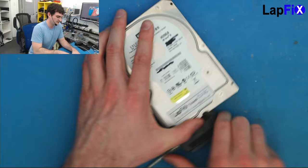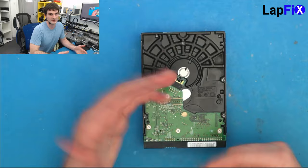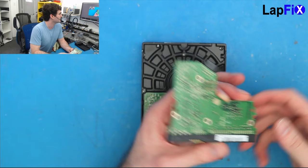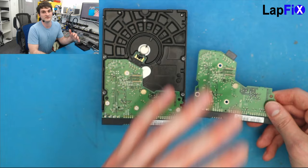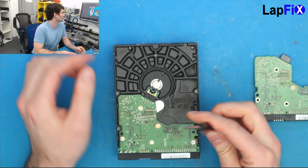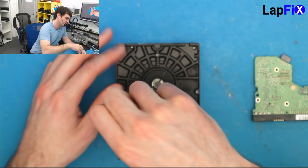What we want to do is remove this PCB board here, because the board is what controls the power on and off. Since the disk isn't spinning, the board must be the issue. We do have a donor board here, and it looks just about exactly the same on the back. You have to get exactly the same model — the same serial number, the same firmware, the same place it's made. You really want to match the chips up. That's the most important thing.